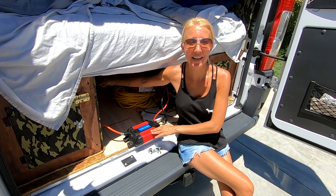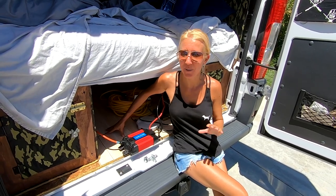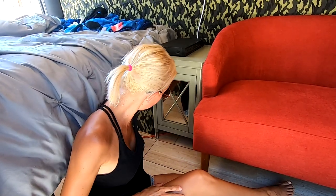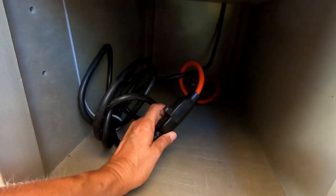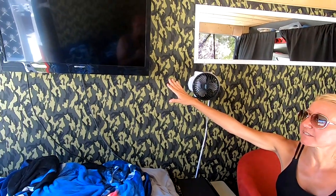From our power inverter, we have AC running to our appliances in the van. Our AC cord comes up through a hole in the back of our cabinet and connects to the power cord. One of the reasons we bought this cabinet is because it has outlets and USB ports in the back. Currently the items we're using in our van are a 10-watt DVD player, a fan with two settings — low is 13 watts, high is 23 watts — and a 42-watt television.